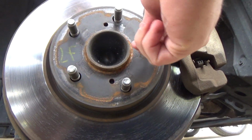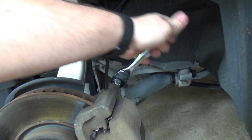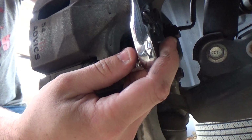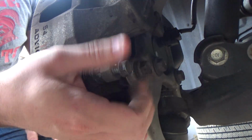All the rotors on the vehicle have been marked LF, RF, RR, and so on. The only reason that this would be done is if a technician removed them and wanted to install the rotors back in the same place. These particular rotors have the same part number, are non-directional, and can go on right or left side, so the factory has no need to mark them this way.